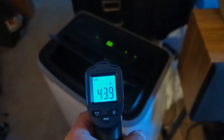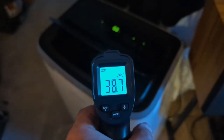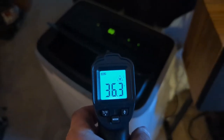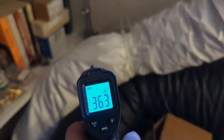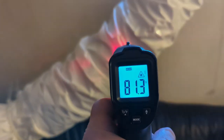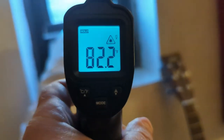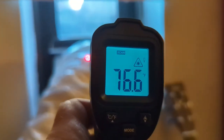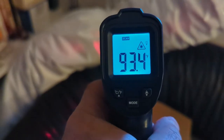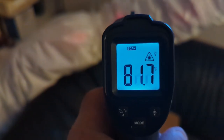Checking the temperature of the portable air conditioner that's been running for a while with this extended hose setup. Aiming it into the inside: 38 degrees Fahrenheit, then 36. Moving over to the hose: 80 degrees, 80 degrees, 82 degrees, 79 degrees. Where the junction is: 92 degrees — a little bit hotter. But right below it it's 80 degrees, and right above that elbow, 81 to 82 degrees.